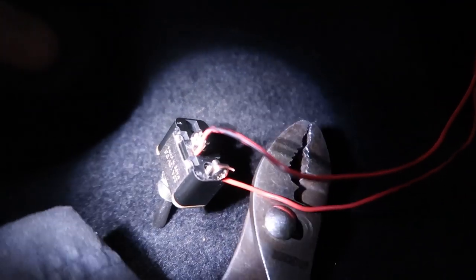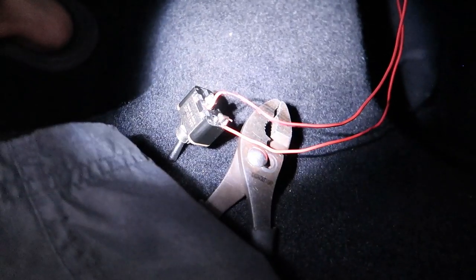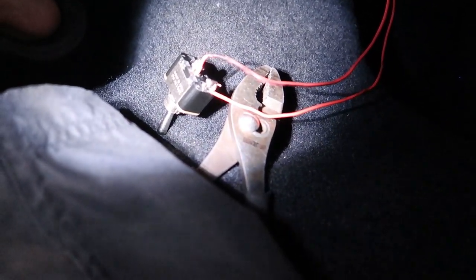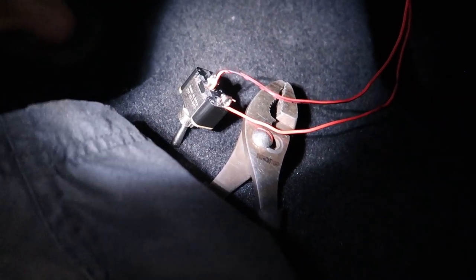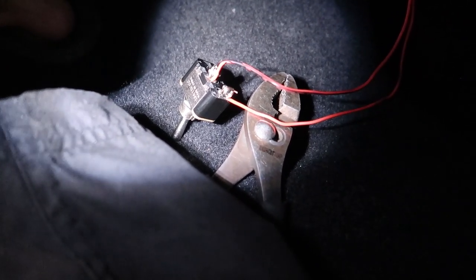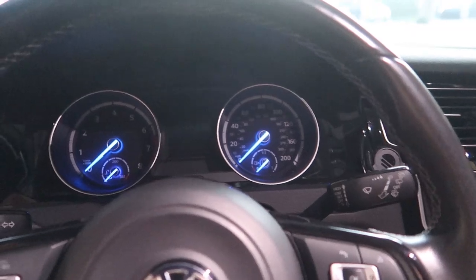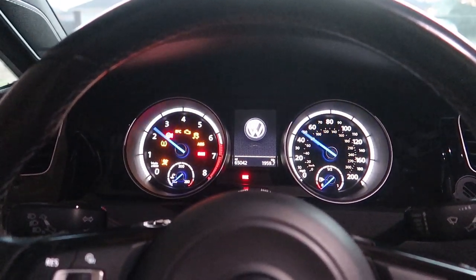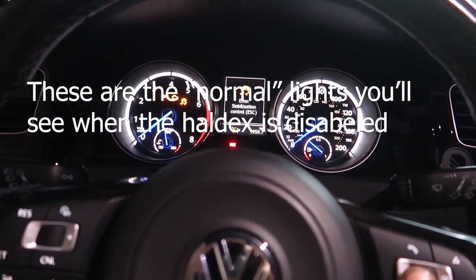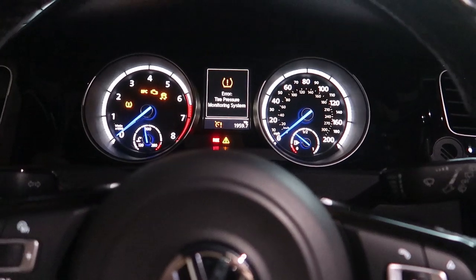It's starting to get dark but I have one wire marked darker with marker. I'm gonna throw the switch up here real quick, turn the car on, and see what it does — see if I need to switch the wires for on and off. If it throws codes I need to turn the car on, then I know it's already set to on. Alright, the switch is set to normal so it shouldn't throw any codes — system ready. It already is throwing them up, so I just gotta switch the wires and I'm good to go.